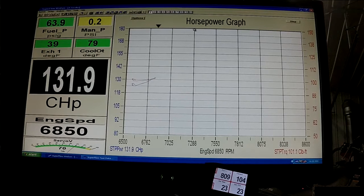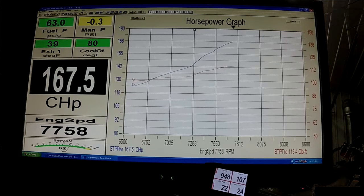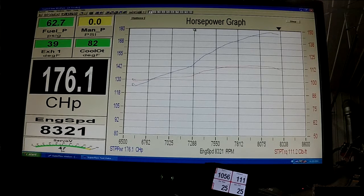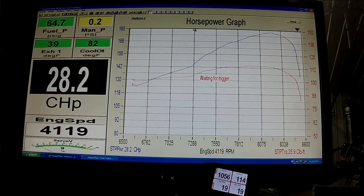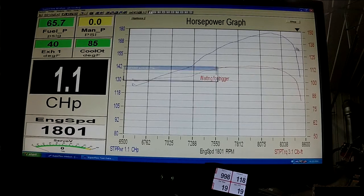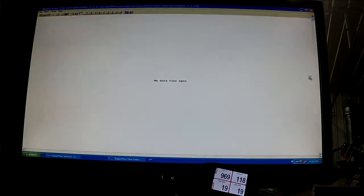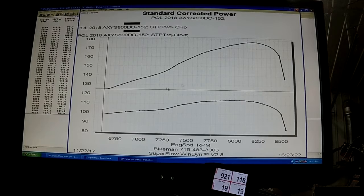A cold pipe will make a little bit more torque, and the horsepower will drop off a little sooner. You can see up in this area it really fell off a little bit faster than it will once it's hot — you'll see that carry out. First run was 177.3 at 8200, but that's going to change.